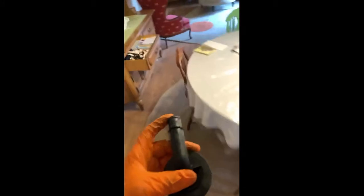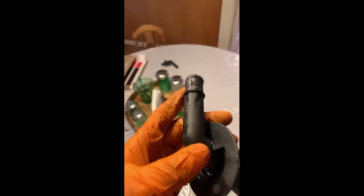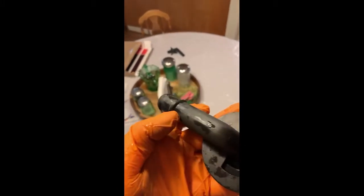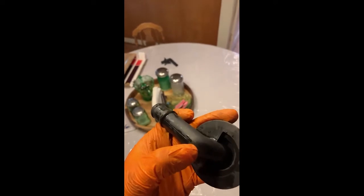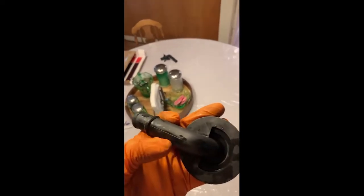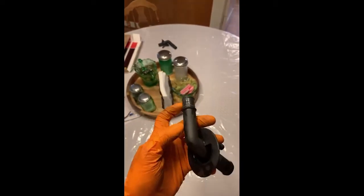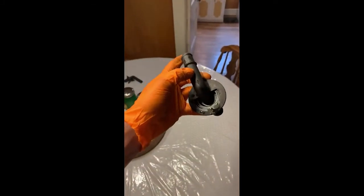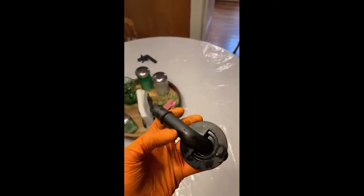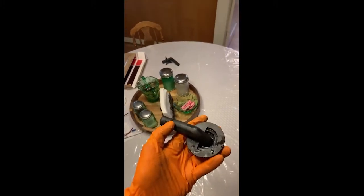The only way I even spotted it was when I cranked the car and could see it spitting coolant out. It's plastic, keep that in mind. On this seam that goes from here all the way down to this elbow, there's a plastic seam from the mold — it cracked all the way down. When I start the car, it just works out. I stuck it under the sink and it bubbled a little bit, then I plugged the two ends, blew in it, and sure enough — crack all the way down.